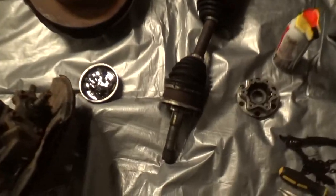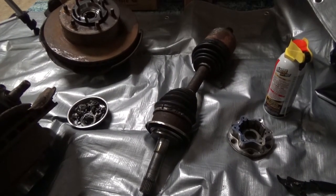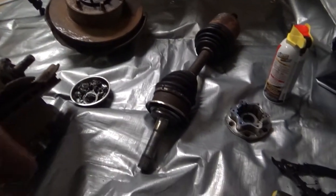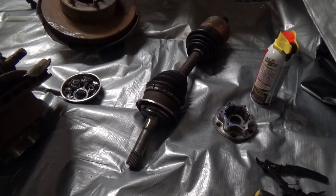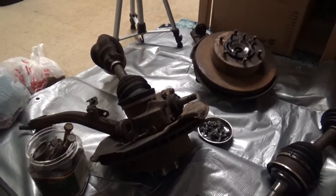Look at this — we got one of the axles out! I was able to finagle the little snap ring off, and then the little bushing right there, and then it is free. One of them is free, ladies and gentlemen. We're halfway through now — we just got to repeat on the second one, which should be much easier because we know what we're doing.